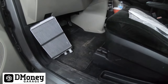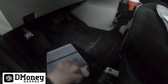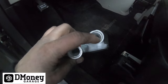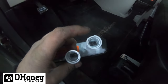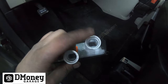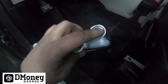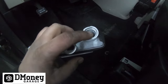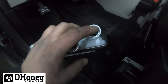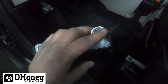Got the heater core from O'Reilly's. They gave me another one because you can see on this end the inside is round but the outside where it clamps isn't very round. I'm going to try this one and see how things fit. If I'm not getting any warm fuzzy feelings about it I'll go pick up the other one, but since the center is round where it actually goes in and seals I think it'll be all right. We'll pressure test it after if I use this one.